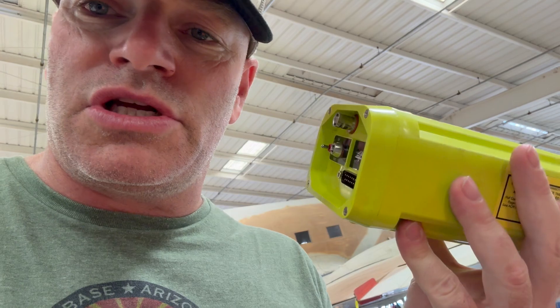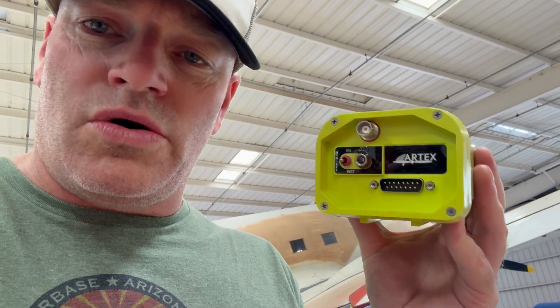I've already taken a look at the battery. There's no corrosion or issues — this is a lithium battery, so it's good to go. The next thing I want to check is operation of the controls and sufficient signal strength through the antenna. With a 121.5 ELT that's pretty easy, but with a 406 ELT you need a special setup. Let me show you what we're going to do.